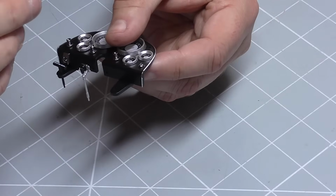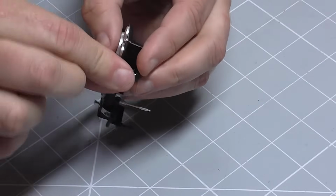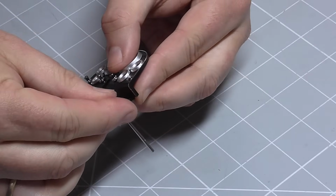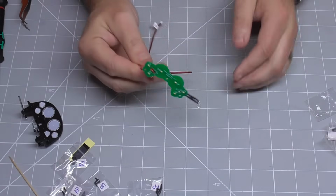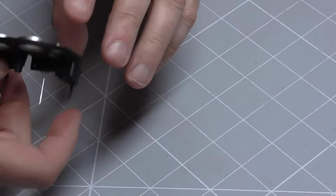And then I'm just going to take the handbrake bar. This one I can make sure is around the right way. Just push it through the hole. So that comes out there like that. Now I need to take some electrics from the car. So I'm looking for lead A3. Not very hard to see that lead because it's the dashboard lights, as you can see here.